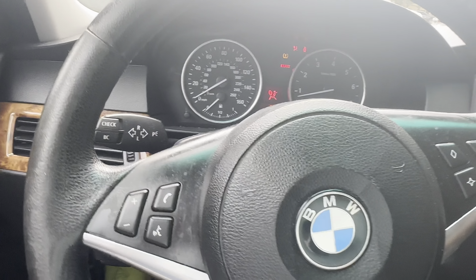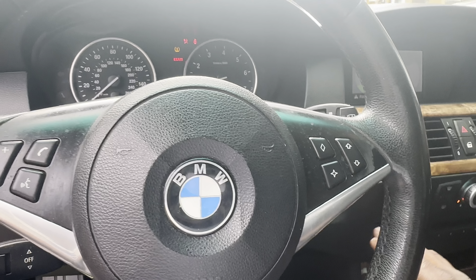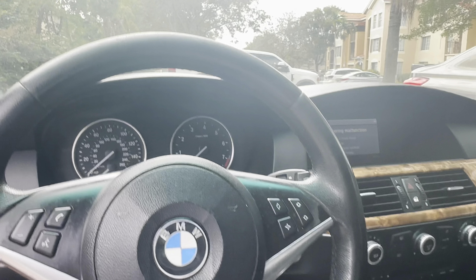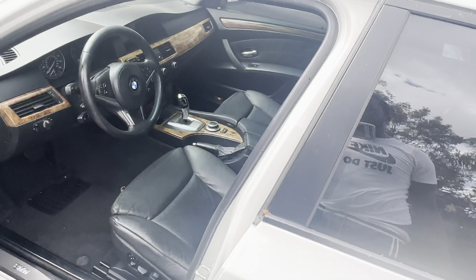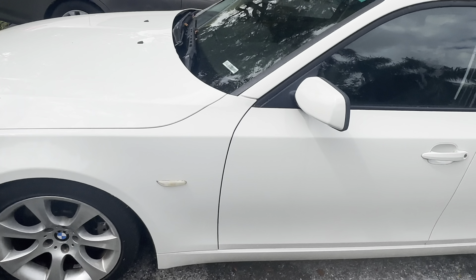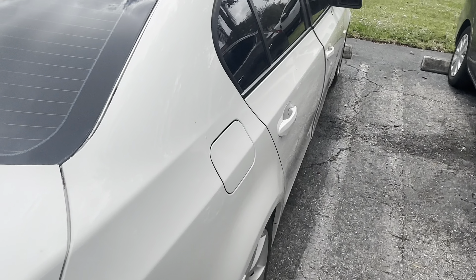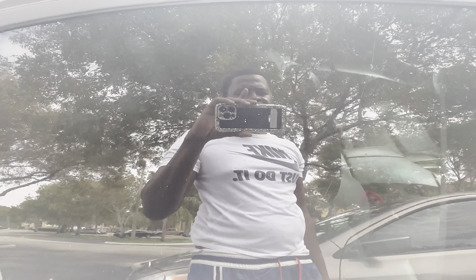I was planning on putting some injector cleaner additives into the gas tank, but I was told it doesn't do anything. I'm going to do it anyway just to see if it improves anything. But that's what we got right now guys — we definitely need some injectors. The car starts but it's just a little rough. Then we need brakes, power steering fluid, and honestly I don't even know what's next. Another reason I haven't touched it is the special T-sockets and E-sockets these BMWs need. Anyway — Menard's Garage, like, comment, share, and subscribe. I'll see you guys on the next video. Peace.